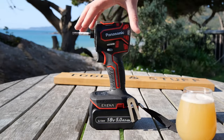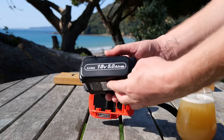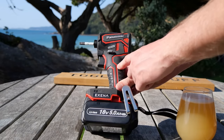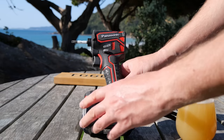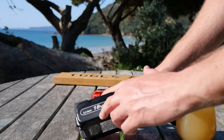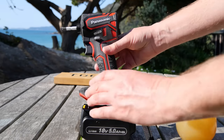Even though this is very short on top, it is not very short at the base — it's pretty bulky at the bottom. This is an 18-volt 5-amp battery, with a row of 5 cells and another row of 5 cells. But this is not just an 18-volt tool — it's a 14.4-volt and 18-volt tool. With a 14.4-volt battery you only need 4 cells, so the battery is only about half the height, making it much more compact although the base is quite long.